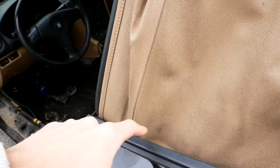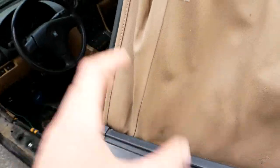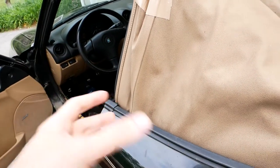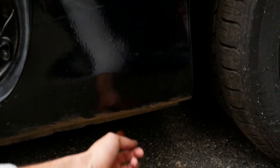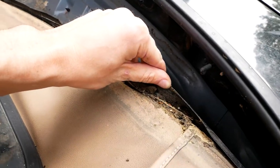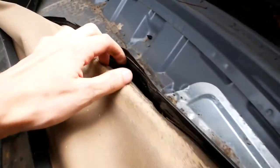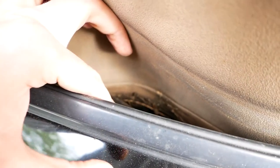It's basically that channel that runs along the back of the top, and those drain out right at the drains which from the outside of the car are right in here on the other side of this top. So that's the location. Now I'm going to vacuum those out, get all the leaves and debris out, and then we need to clean out the drain which runs down through the car and drains out right down here at the bottom. On this car I'm actually replacing the top, but you can see how much junk gets caught up in this rain rail — this is all the debris that gets down into the corner drains and clogs it up.